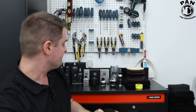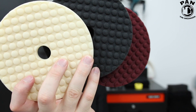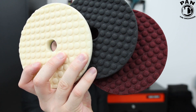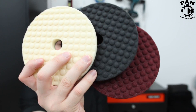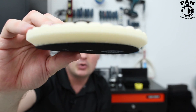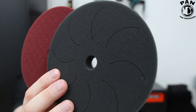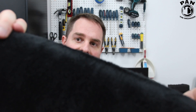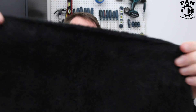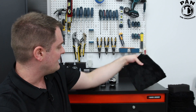To go together with their backing plate, Kamikaze Collection have a bunch of amazing buffing pads. They have their Bonsai Dynamics polishing pads — the white pad for hard paint, red for soft paint, and black for final finishing polish. They are very thin and the ABS compound found in the pads is a great combination for automotive paint. They also have a wool pad and some other foam pads. Kamikaze also have their own super plush microfiber towels. They're laser cut so they have no edges — that way you won't scratch your paint. These are for finishing polishes, removing waxes, applying the sacrificial layers on top of your glass coatings, and removing your glass coatings.